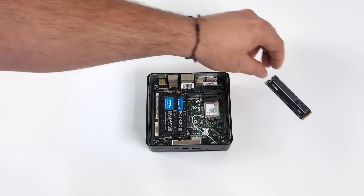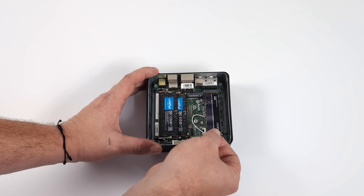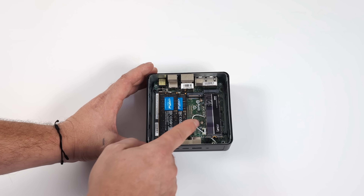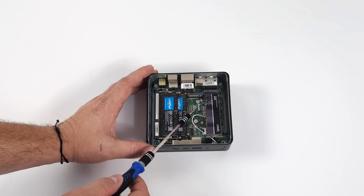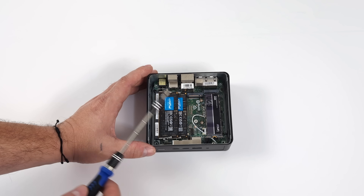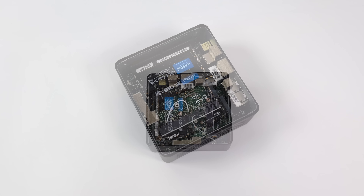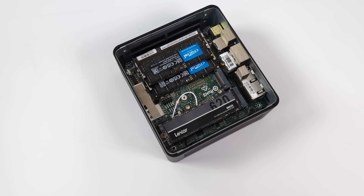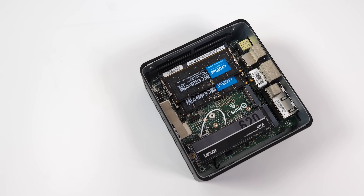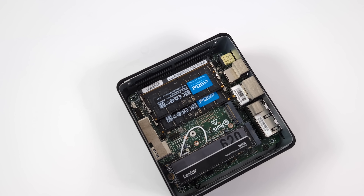The fastest RAM we can go here is 5600 megahertz. When it comes to our M.2 drives, it accepts one 2280 and one 2242 — both of them are Gen 4 drive slots — and I just went with a one terabyte Lexar 620 M.2 drive, with that 2242 Gen 4 slot still free. One thing I was really considering was adding an Oculink eGPU to this system. If that's something you're interested in seeing a video on, let me know in the comments. We can actually build a pretty cheap dock using parts from Amazon and really up the GPU performance on this thing.